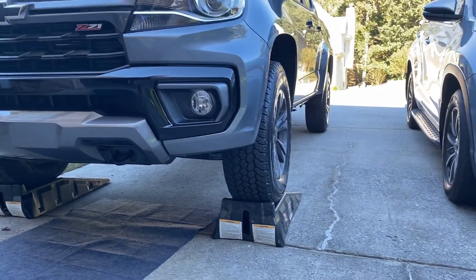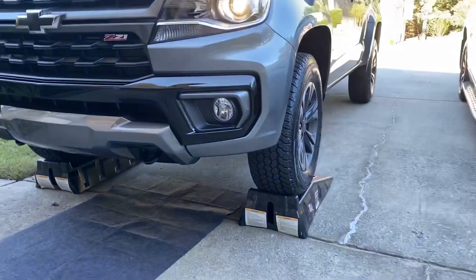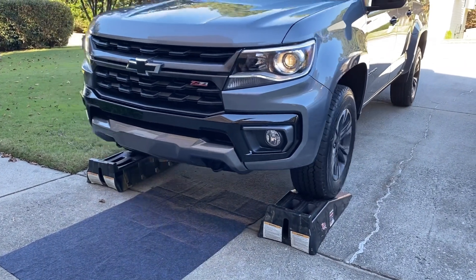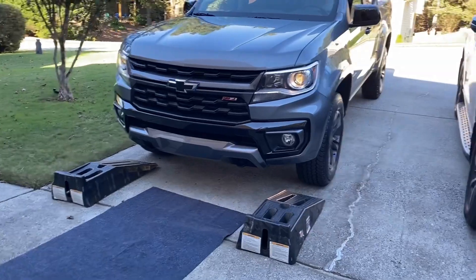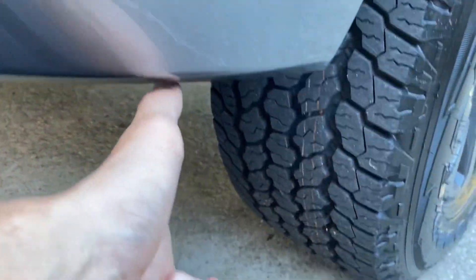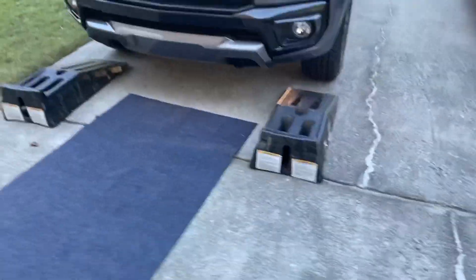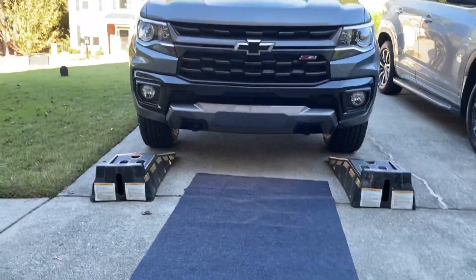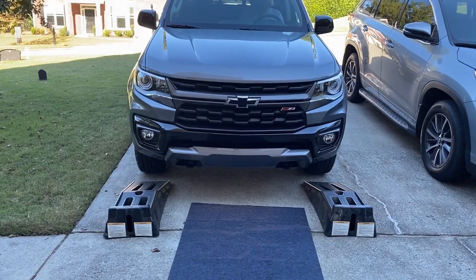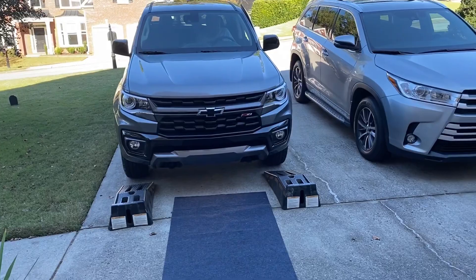Before, the air dam was scraping on the ramps — now let's see what it does. No scrape. We measured it and in the thickest part right here it was seven inches, so you gained seven inches of ground clearance with that removal for maybe a mile a gallon less. You got a truck — you don't get a truck for gas mileage. It was very easy, and hopefully it helped. See you guys in the next one, thanks for watching.